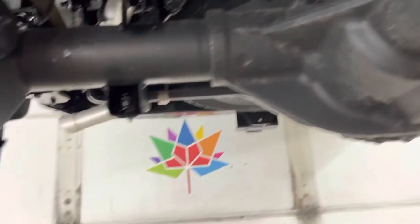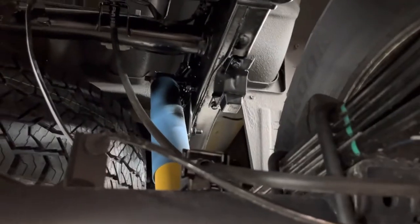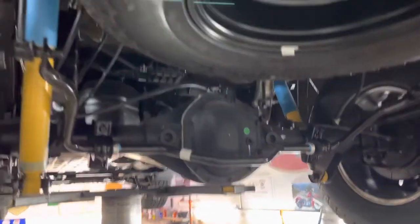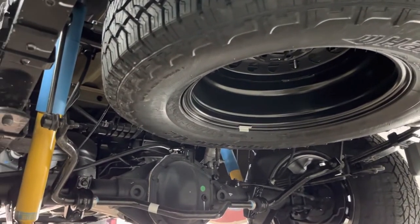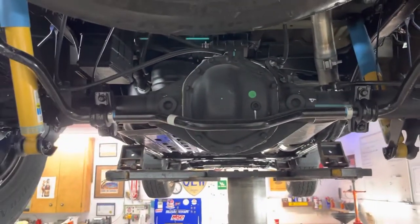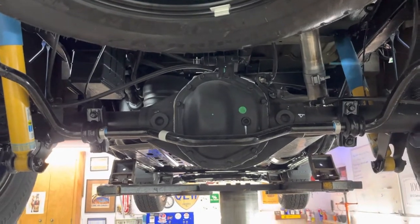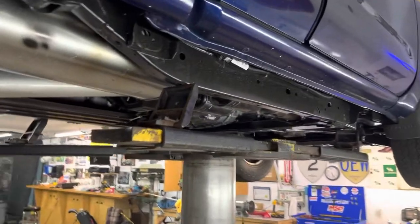All the bolt heads on the shocks — basically anywhere I can find something that hasn't been painted, I just give it a shot of paint. It's June here now, and in September I have a friend that does undercoating, so he'll come over and this vehicle will get a really good oil spray before winter — a few months before winter to give it time to soak in. I undercoat my vehicles every year; for the 110 bucks it costs me per vehicle, it's a no-brainer. The Pro 4X I just turned in didn't have any rust on it at all.